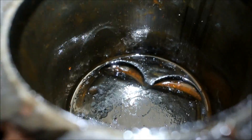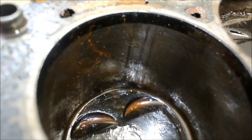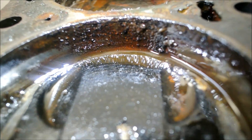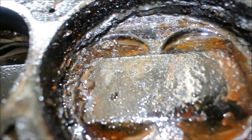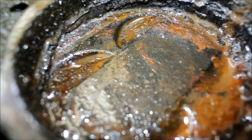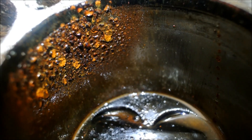Here's a look at the pistons. Cylinder number one and piston number one look the best by far. The bores don't seem too bad although there's a bit of rust. Number two is similar to number one with actually a bit more rust on the bore. Number three is a total nightmare — it has rusted into oblivion and this is the reason the engine has seized and it's impossible to move the crank. Number four is a bit better but still has quite a chunk of rust.